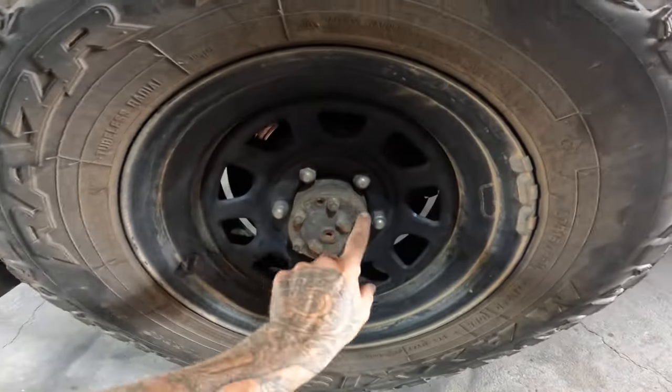I'm going to set this camera up, jack this rear up, take the wheels off, pull the axles out, and off we go. The rear I can actually just loosen my axle and just sleeve that out. What I'm going to do with my bearings is put them in the oven to heat them up, and then just slip them over the center once it goes on.